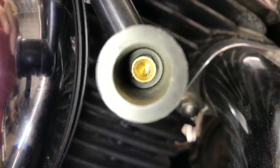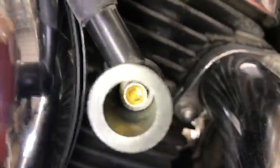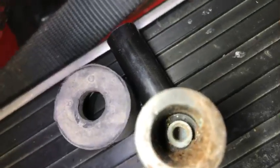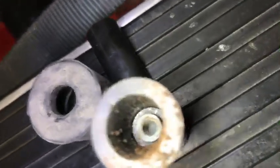Inside, down the back, you can see that little wire — there's a good shot of it. That wire drags across the threads and that's what retains it, what stops it from vibrating off. Now look at this bad one — not only is there a lot of crap in there, you can see the corrosion, which would have caused a weak spark. It's just not a good fit.